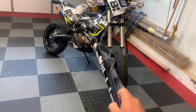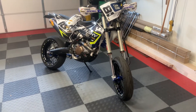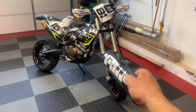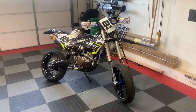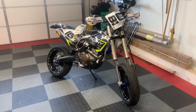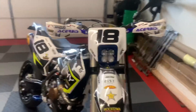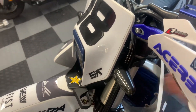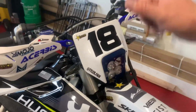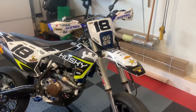These plastics you actually need in order to fit that tire — you're not going to fit them with the stock ones, you're going to have to modify in some way. I'm going to get that fender on the bike and then show you exactly how and where to cut yours to fit those bigger, fatter, stickier tires. Just like that, the front fender is on — it's super easy. If you have a Husqvarna or a KTM it's the same exact thing: you've got two little tabs here, grab that, pull it off on both sides. The headlight comes up and out, the whole assembly goes out, then you've got two bolts back there and two bolts there, and the old one comes off and the new one goes right back on the same way.